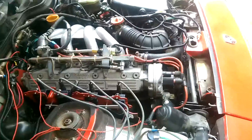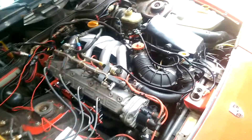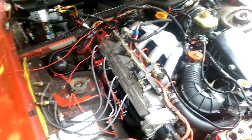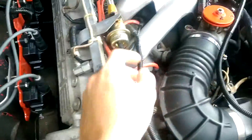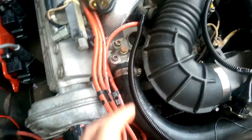The car is pretty much ready to start. I've just got to install the new injectors, install the 951 throttle body, and throw together some tables to start the car — set the cranking pulse width for the injectors and so on. I also have to come up with an ignition map. But all the wiring is pretty much done. I'm still going to use that little idle air valve back there.